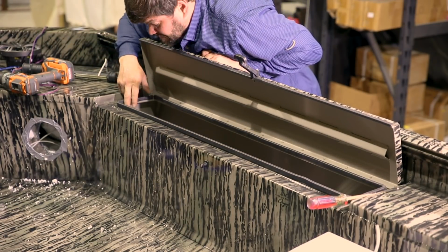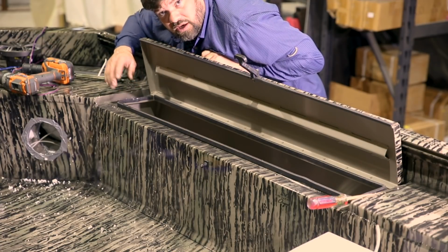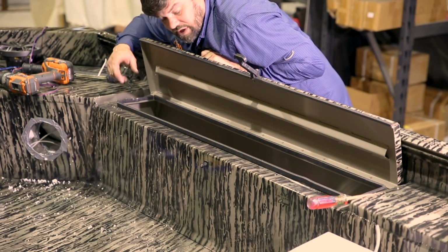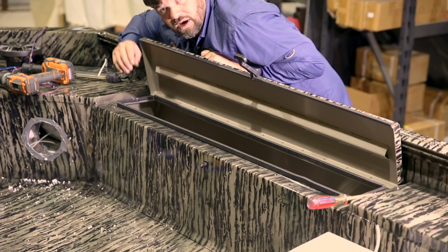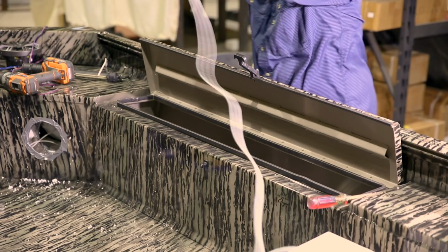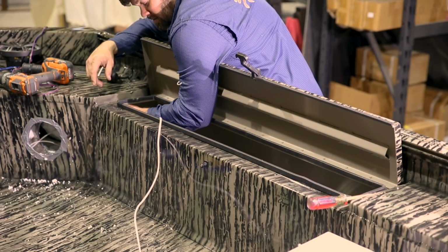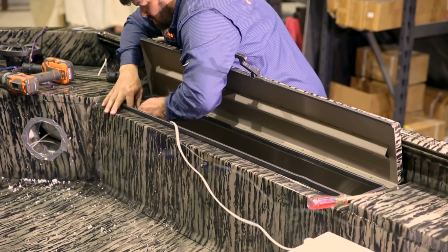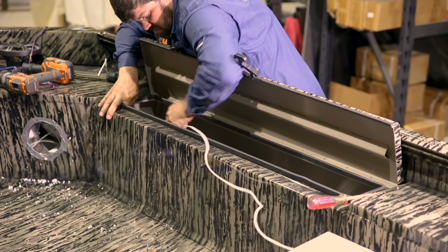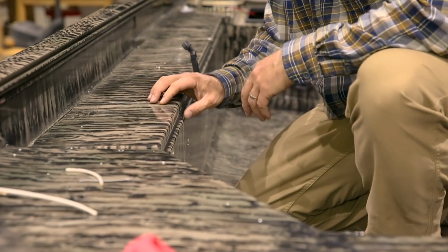Once again, when you're running these wires, you want to make sure that you eliminate the sharp edges on the holes that you drill through. You can take some silicone and put it around the wire, that way the wire is not bouncing around, accidentally getting cut. That works real well, or wrap a bunch of electrical tape around that part of the wire to give it more protective coating. So once again, running our 16-2 high stranded copper wire. Push that through. Should be enough.